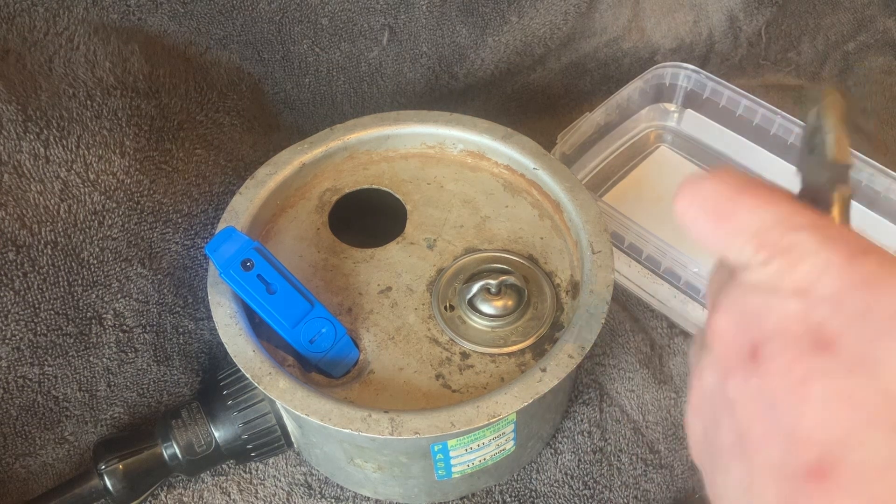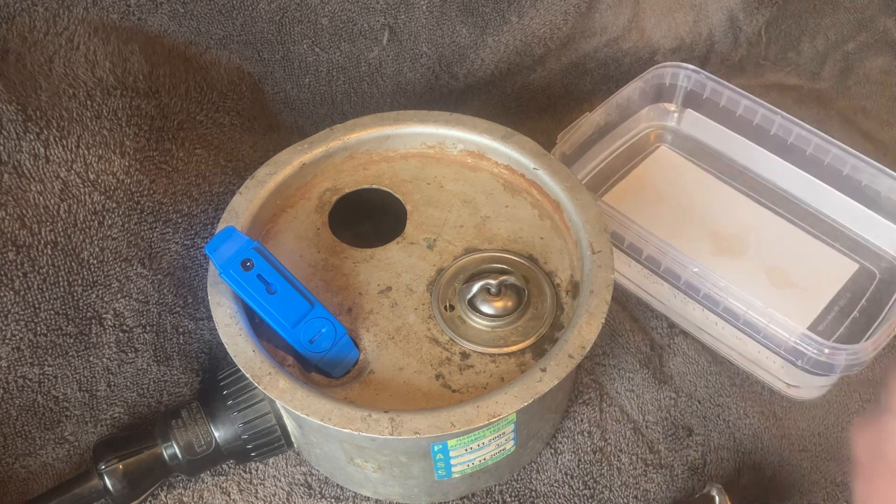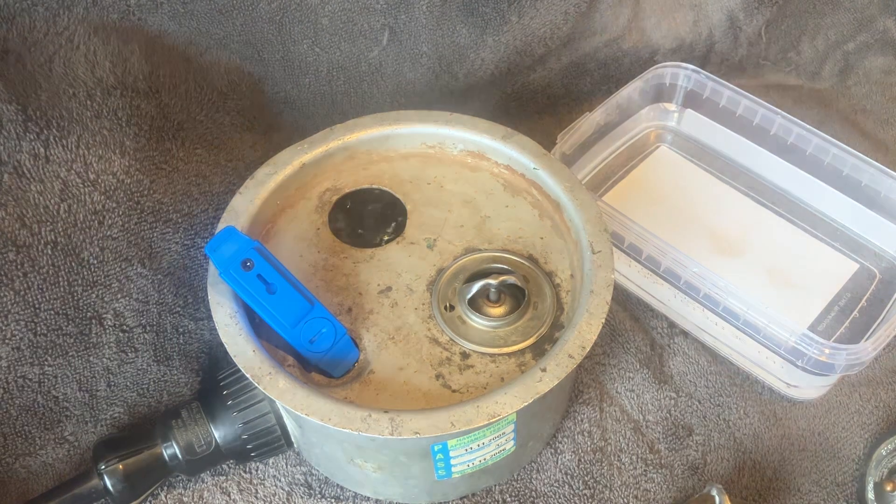You can start to see some daylight just up here between those two sections as the middle bit is dropping down. If I allow this water to boil a little bit more you will see water passing up through it. The middle section has dropped down — this one's not seized. It is operating correctly; it would allow coolant through to the radiator.